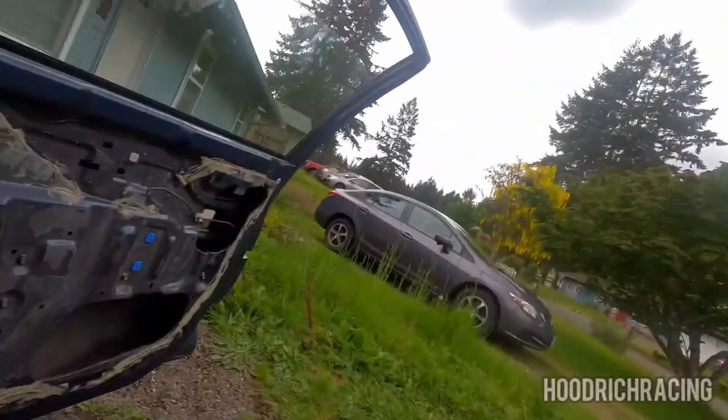Earlier I said the car weighed 2410-ish with the turbo and a B-Series swap. Stock weight would be 2275 for the DX model, because we do have manual windows now, front and rear. I did do the rear one too, off camera. No sunroof, no airbag, so 93DX. This is originally an LX, so remember that. A 93DX with a turbo and a B-Series, you're looking at about 2410. Minus, well, around 310, I think. So yeah, that'll get us exactly what I tell people, around 2,100 pounds.